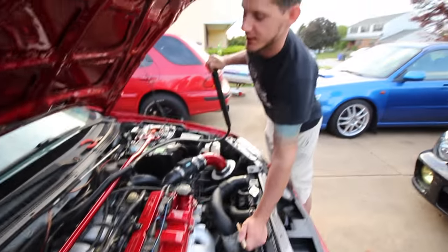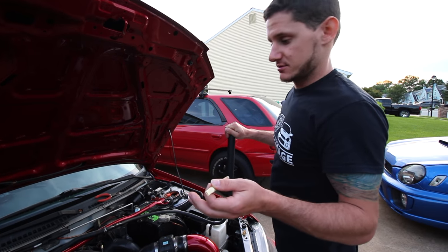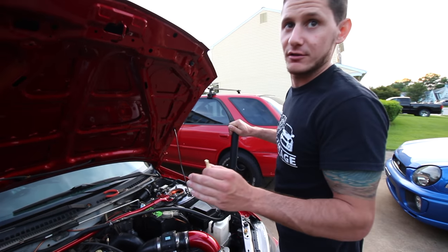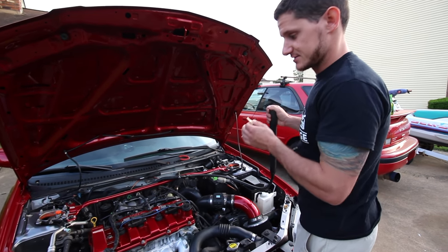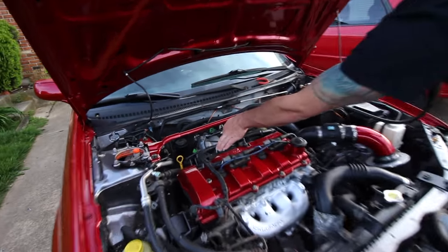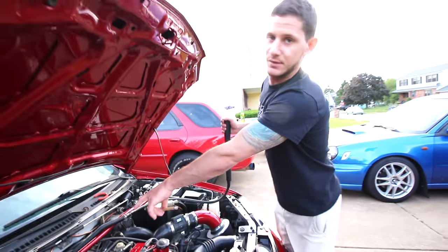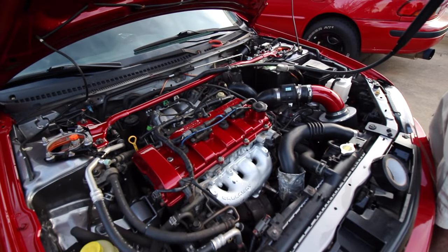I did the same thing when I had problems idling and misfires, and the system said it was too lean, so it was getting too much air and not enough fuel. A vacuum leak. I did this test and there was smoke coming out right down there somewhere, and it turned out to be the intake manifold gasket, to the back of the head. I replaced that and it ran great after that. That makes sense. Without gaskets, you're not keeping boost, for sure.